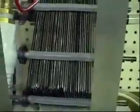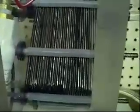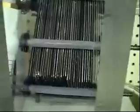That's what I use. If you want to go above this, you're going to take the 1/16 neoprene gasket and double it up in every spot, so now you got a 1/8 gap between every plate. So when you get to higher plate numbers, you want to use a bigger plate gap.